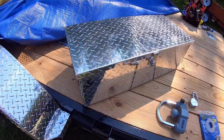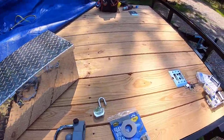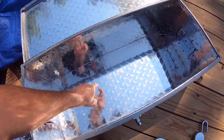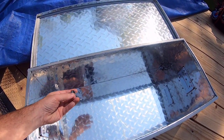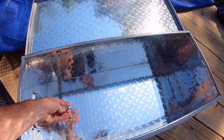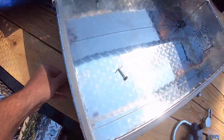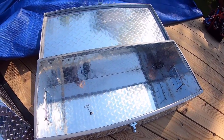With the box, I really like this idea that it had handles on it, even though I definitely need to mount it semi-permanently to the trailer itself. I came up with this idea to cut a couple of holes in the bottom of this, and then have these pins come up from the trailer bed — with some little bushings on them — so that I could easily remove it. I can pull these little pins out and then pick the whole toolbox up with the handles and carry it and move it anywhere. For the most part, though, I'll probably leave it permanently.